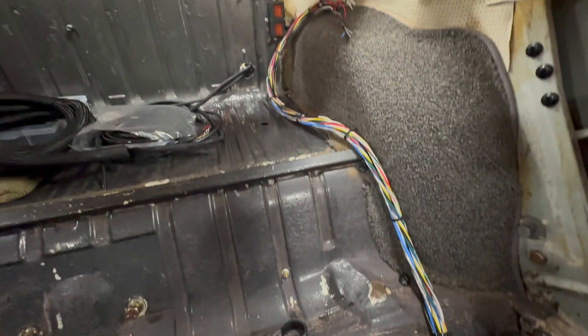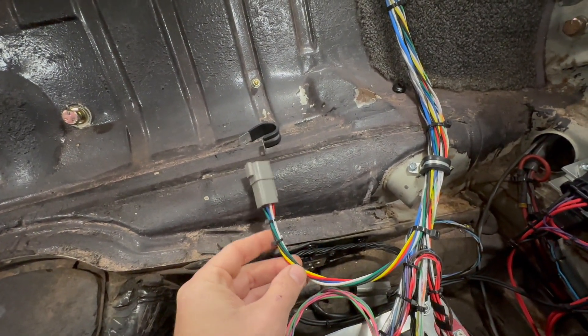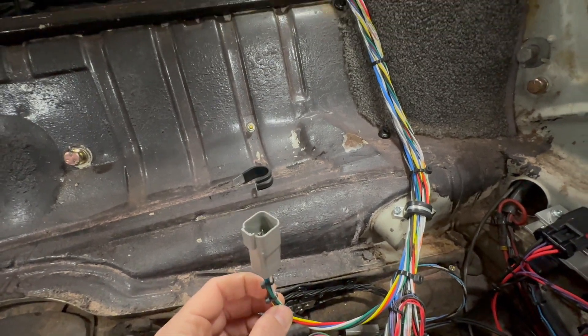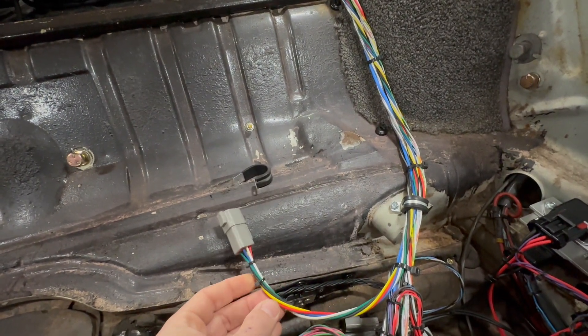There's a six-pin connector that runs up to the firewall connector — there were exactly six extra pins left open after termination, so I'm going to terminate everything at the firewall for future expansion. I've already got the remaining six wires ready to go. It's a lot of tedious work, not a lot of fun to film or watch, but I wanted to show you where everything's at so far. Today's task: we're going to try to get that firewall connector terminated and wrap up the in-car side of the wiring harness so we can get started on the engine side.